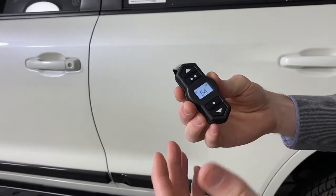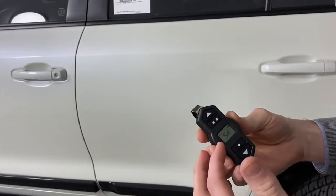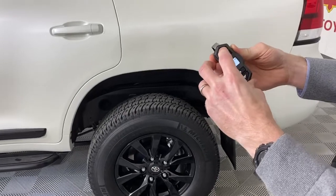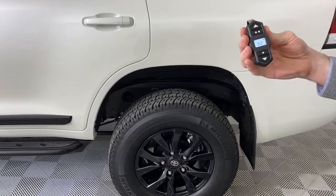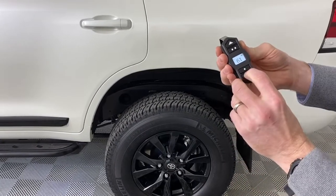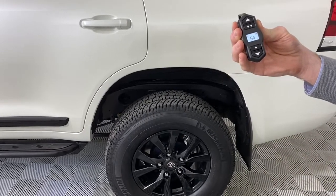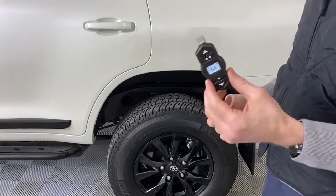You can set your PSI to anything you want — anywhere from 5 PSI to 99. Right now it's set at 54. So if you want to adjust your rake or your load capacity for towing or whatever, just set it to whatever PSI you want and let go. Same thing to take it down. You can also do it from an iPhone app if you don't want to have this device in the car.